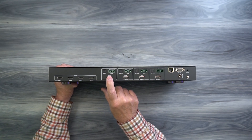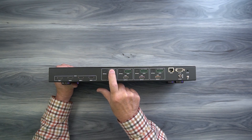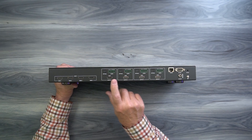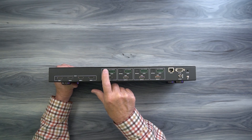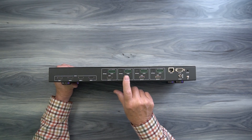You'll also notice that for each of the outputs there's an optical S/PDIF and a left and right analog audio output. This unit provides audio extraction capabilities where it can separate the audio from the media content being displayed in each output and allow you to pass that along to a sound bar or a home stereo through either one of these connections. There are four separate audio extraction channels — one for each output.